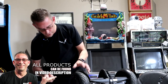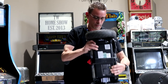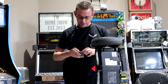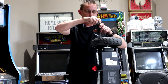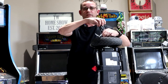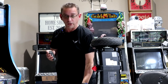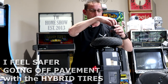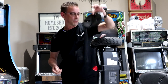We're going to be replacing these standard tires with hybrid tires — they're good for on and off road. Once you get to this step there's going to be four screws in here. Take your hex wrench tool and find the right size. Take these four screws out and that will remove the plastic hubcap. I can't wait to see how it does going off a sidewalk into the grass. After we get these installed I'll compare it with one of my other Segways with the standard tires.